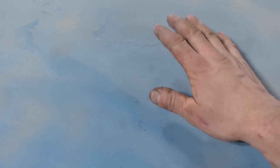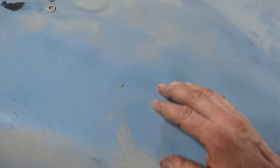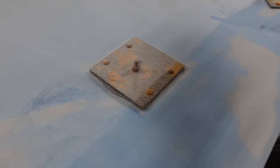I don't remember what this looks like when we first got it, but working with Tim from Industry Garage and Ryan, when we did the carbon fiber on the Audi, he said, not a big deal, put a layer of resin on this, put a fresh layer of fiberglass matte on it with one more layer of resin. Put a little resin on first and let it sink into the cracks, because when you put the matte on it, it'll kind of pull the resin up. So we'll blow this off. No real way to prep this. It's really rough from the sandblasting, and the resin should go into the cracks and hold it nice and tight. So we'll try that, cut around the plates that are holding up random things inside the cab, and see what we can do.